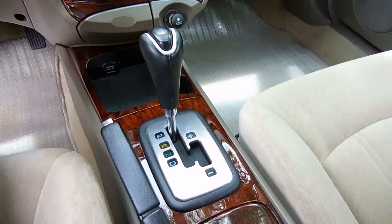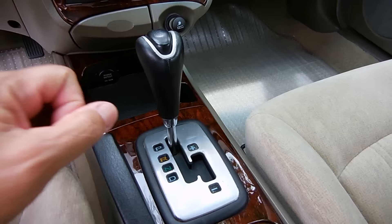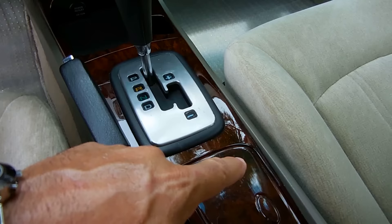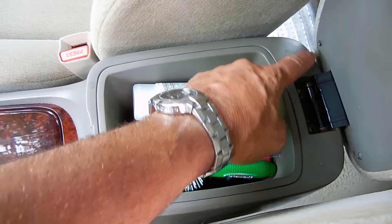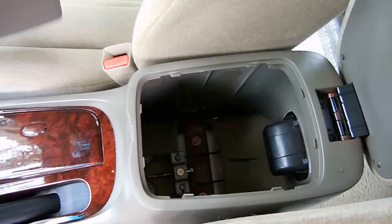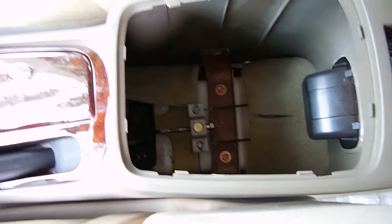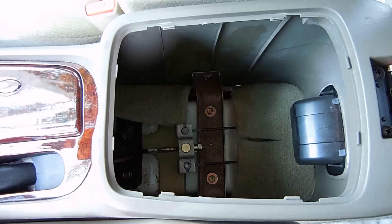This plastic pops out as well with clips. Gearshift knob — pop this piece of plastic off, take two little pieces out, and there's a nut. This slides off, and then there's four screws holding this plate down so I can swap that out. Using the tools, carefully pry along the edge until all of this is open. The two sockets are going to be positioned right on the back edge over here beneath this hinge. Luckily with this vehicle, all you do is pull out this basket — it makes life easy.